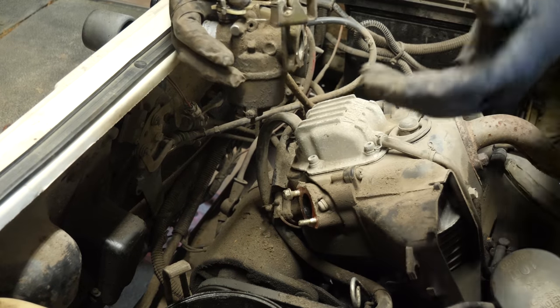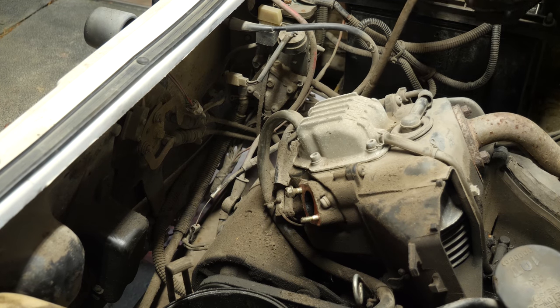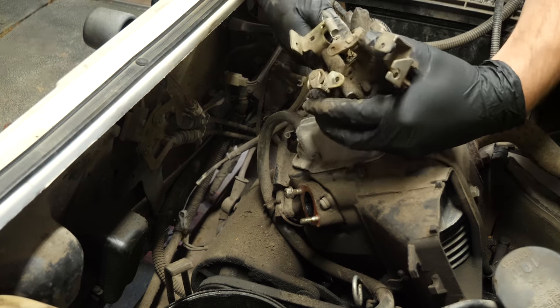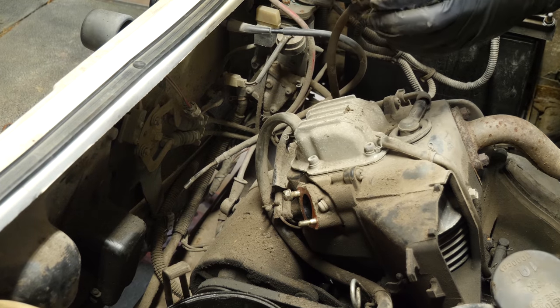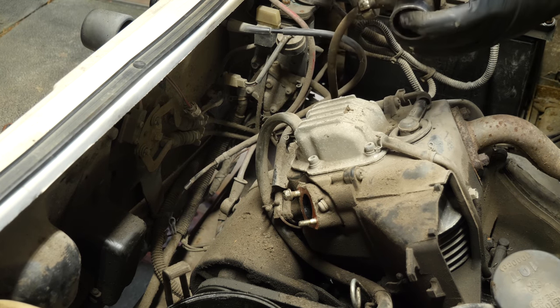I see a lot of gas in there — actually, I see water in there. So I think that's where our problem is. Once you get it past the nylock part of the nut it just comes right off anyway. I grabbed the fuel line and I rotate it with the pliers just to make it that much easier to slide off. Doesn't always work that way though.